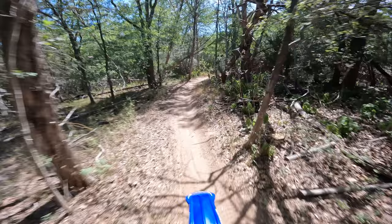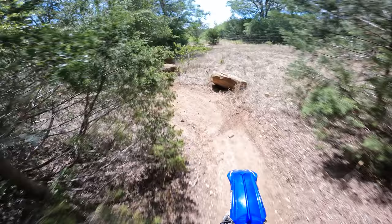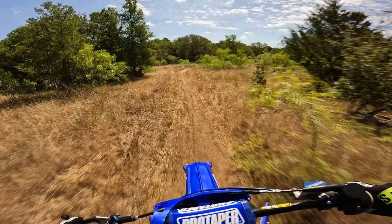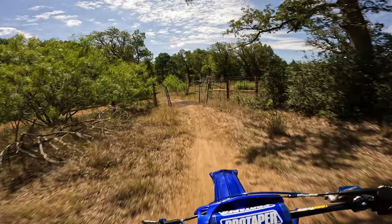If your bike's bogging at any point in the RPM, you're having issues, and that's a little bit more on the extreme side of bad jetting. But just from a slightly richer or slightly leaner tuning perspective, like within safe margin, you'll make more power running a little bit leaner, you'll have better response, your bike will run a little cleaner. But running rich is safer for the motor long term, you'll make less power. But you'll have cooler operating temperatures. Oh, bike died.